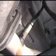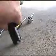the next thing we want to do is remove the oxygen sensor. Now there's a couple of different ways you can do that. You can either do it with an open-end wrench, or they do make a socket that fits on an oxygen sensor. Today I'm going to be using the socket that's specifically designed for the oxygen sensor. You'll see that it has a slit in the side. That's going to be for the wire.